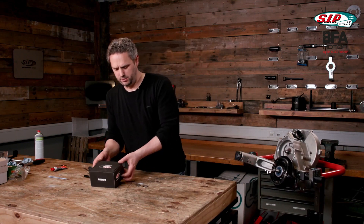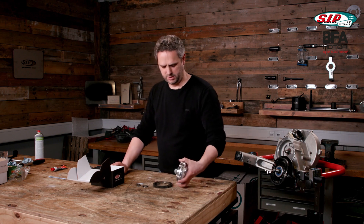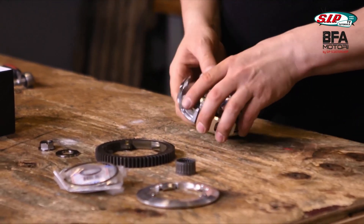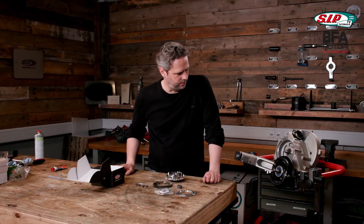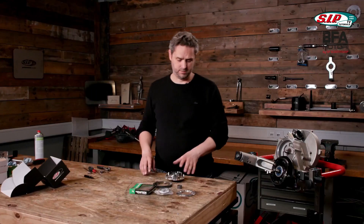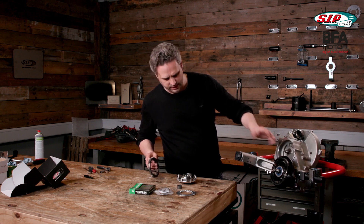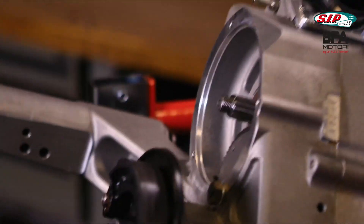A few other things are still missing, among them the clutch. The clutch supplied by BFA is something unique in the way it works — nothing like it in the market. We've shot a video about that where we talked about everything in detail: the components that comprise the clutch and how it works. And that clutch precisely I will now fit to my engine. All parts here. I'm using a version with 24 teeth to get a slightly taller transmission ratio. The primary drive has already been fitted, and I'll now start building up the clutch and fitting it.